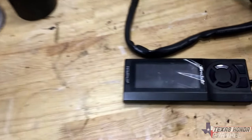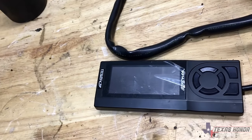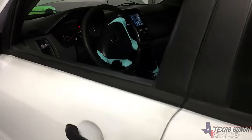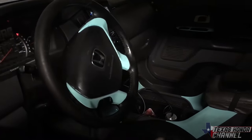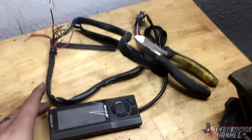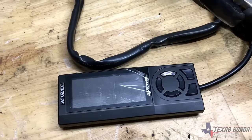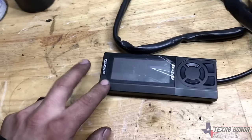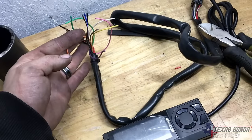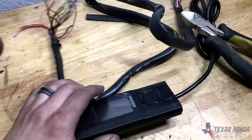I will also be installing this Apexi Neo. That's how we're going to be tuning this, or at least hacking it, because they don't exactly have a Hondata for the Honda Pilot. This is all experimental. I'm pretty much laying the base foundation and hoping that someone else takes over and literally makes all the cool parts for this. The Apexi Neo is going to be the piggyback that I'm using. You can find them on marketplace fairly cheap. Buying them brand new is like $500-$600. I'll leave a link in the description for their website. You want to get the one that does VTEC. This one here does VTEC. I didn't pay a whole lot for it. So I'm going to be installing that in a separate video.